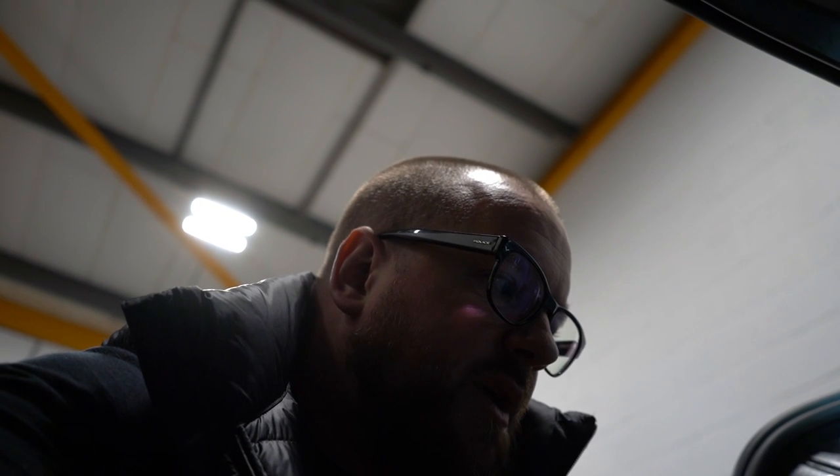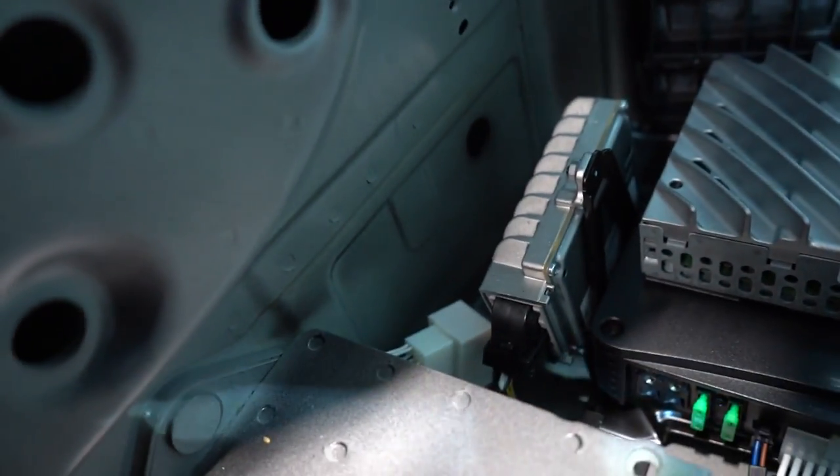We're gimbal-less at the moment, so you're going to have to forgive me. But that is the amplifier fitted. We've repurposed the input from the HK amplifier into the F8.9 bit. We've kept the HK amplifier there — it has no duty, so it's not going to run anything now. It will stay cold but it will just be there. I don't want it to throw up any errors, so it's better it stays. There's an ASD — we've put an ASD delete harness in, and that's where we've done most of our modifications to get the signal. The way these cars run: from the head unit to the ASD module, they go through that, come out to the amplifier, and off they go from there.